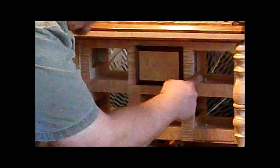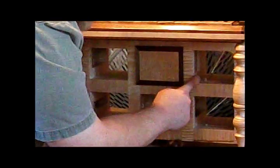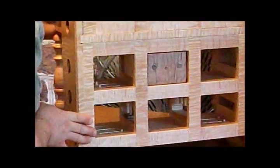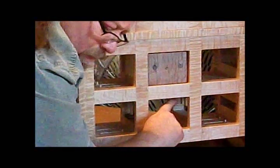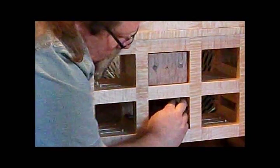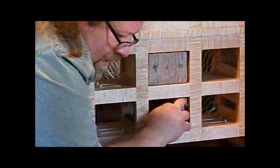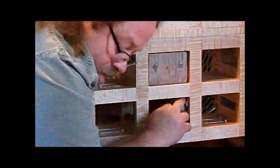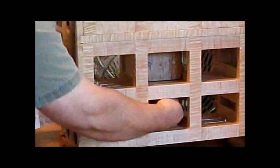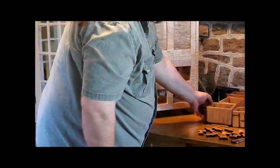Next, you have to take these sliders that are in the compartment space for drawer number 1 and push them all to the right. Turn this around. It's hard to grasp. Up in here is another little compartment, a little handle, but it's kind of disguised. You don't really think it's a handle. And you really need to reach up there with your fingers and pull it down. It'll come down about 3/8 of an inch. Once you do that, the teeth are withdrawn from the drawer and you can remove it. And here's the last and final puzzle piece.